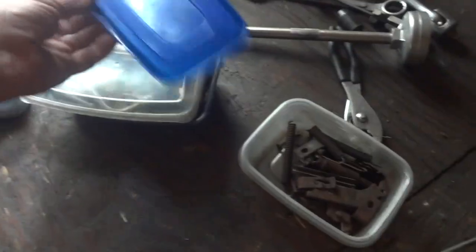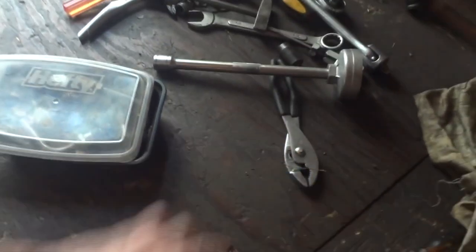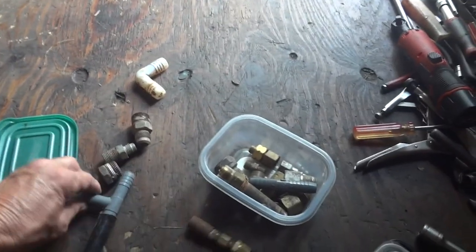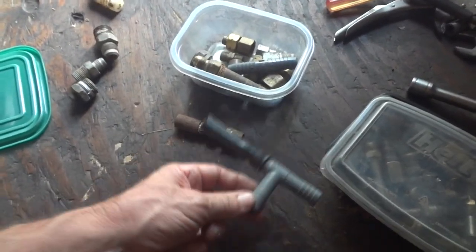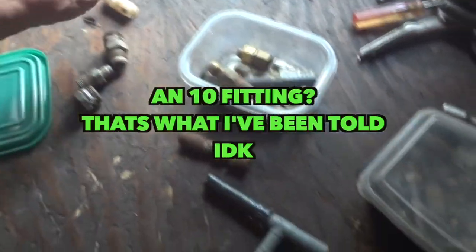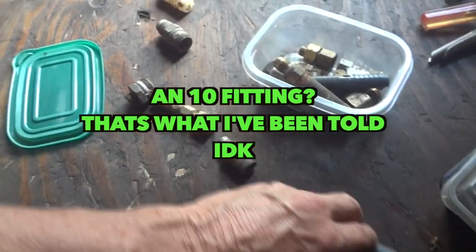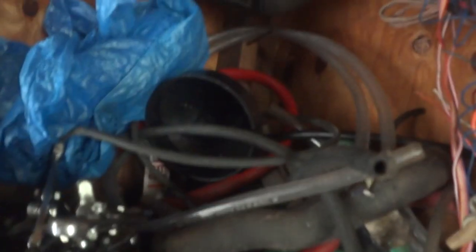Well actually this is expedition 2000 expedition brake parts — I even kept that! Look at that gold right there, you never know what you're going to need. So what we're going to do is sort out what we need. We'll need a T — something like this. Now I know the bottom hose and the top hose — I don't know if they're the same size, I think they're slightly different. We've got to get an AN-10 fitting in there, and I will need some tubing — I've got tons of hoses and stuff up there.